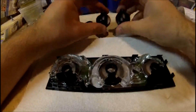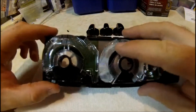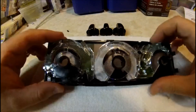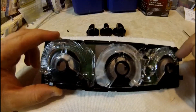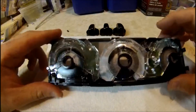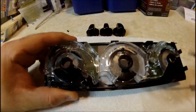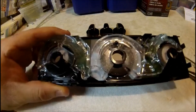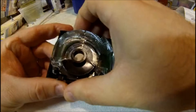After that, I'll move on to the actual faceplate. Now that I've finished removing all the green tint from the knobs, the next thing I need to do is carefully remove this plastic light diffuser so we can get at this green tint in the middle. We're going to take that out and then just put the light diffuser back in without the tint, because I want to do away with the green. You'll notice there are these little tabs, so I'm using a small flathead and some needle nose pliers to carefully pry this up very gently so I can get to the green tint underneath.